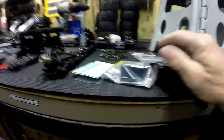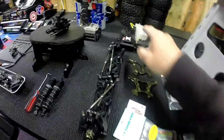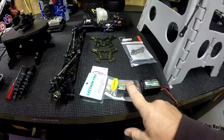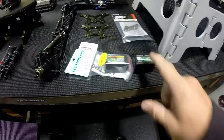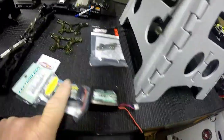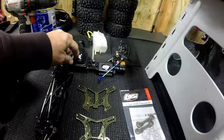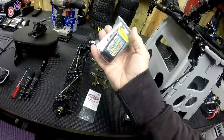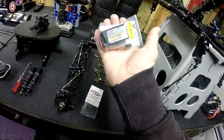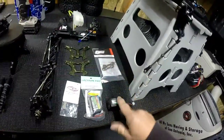It's a lot smaller than the Reedy pack. It will fit in the Losi C box receiver battery box a lot easier - you're probably still going to have to mill it a little bit, but you can fit this one in a lot easier. I had a hell of a time getting the Reedy to fit, but I did it without any damage. Just get a Dremel and mill the underside where the little humps are. This Lectron Pro - I've never used one before, but it's a 2000 milliamp 5C LiFe battery, 6.6 volt. Should fit just fine, a lot better than the other one.